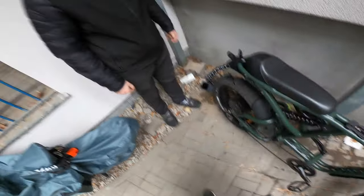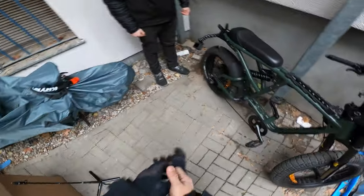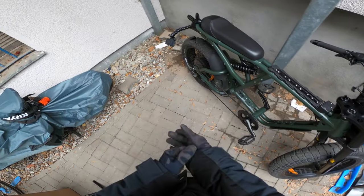Last time the tech put in 7 bars of air. And definitely that's too much for this kind of tires. It should be at most 2.5, exactly. So let's go ahead and get this thing out of here.